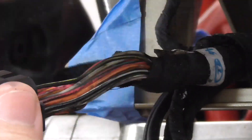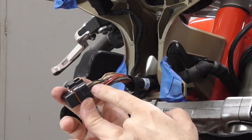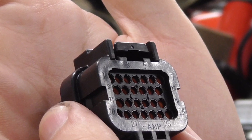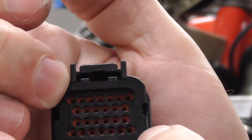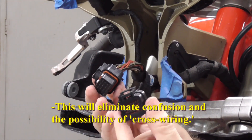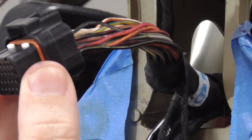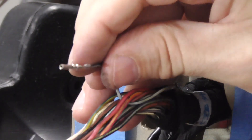So you can see all of these dirty wires. I took a couple of minutes to figure out my strategy, and instead of risking getting these wrong — if you take a look at the back of this connector, you'll see there are numbers. Number one starts in the top left corner and 26 ends over here. So I'm simply going to start at the top with pin number one, pull it out of this one, and then push it into the new receptacle. I've identified this wire as pin number one — with the connector unlocked, we should be able to pull these straight out, just like that. There's number one.